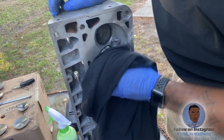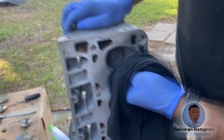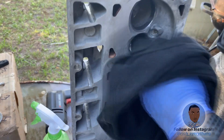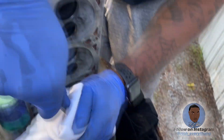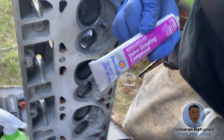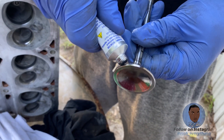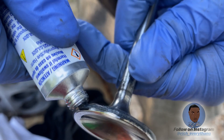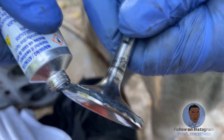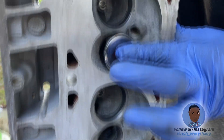Let me do a little cleanup — I go back and get that compound off so it don't contaminate. I'm gonna degrease this whole head all over again anyway, move everything up before I put the springs back in. So the compound I'm using right here is Permatex valve grinding compound. What I'm gonna do is put a little bit on the surface — I ain't trying to be stingy with it, but it don't take much once you get it on there. Even it out and we're on valve number two. Slide it on in.